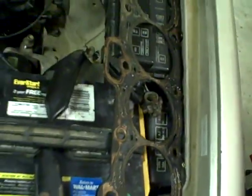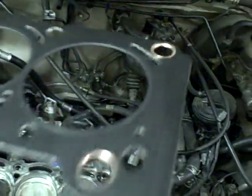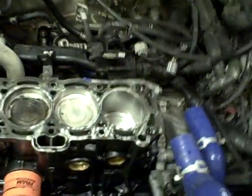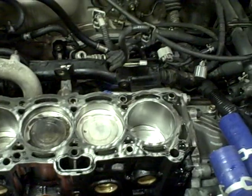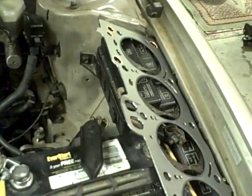Now this head gasket is being replaced by an all graphite and metal one, much thicker, much softer, which will seal much better and easier with surfaces that may not be 100% truly level and square. Now, granted, the head and the block on this engine are brand new, clean and flat. I checked them, but just not flat enough for that style of head gasket.